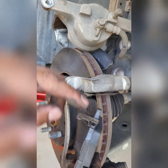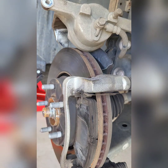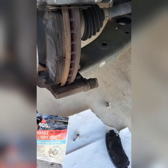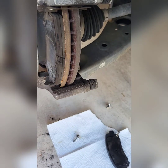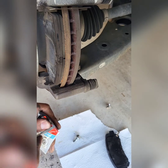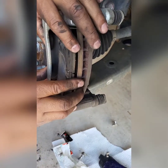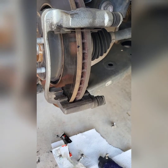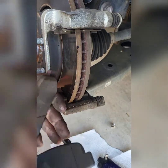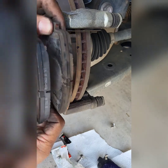Imagine the old days when you used to get down to the indicator! All right — you want to put some brake lubricant on the backs of your pads and your hardware before you put them on the car. Pop out the other one — that's the old one. Keep it in hand because you want to hold it up like this to make sure you've got the right matching front pad.